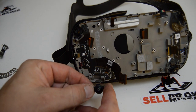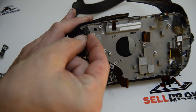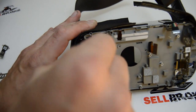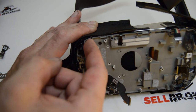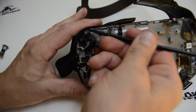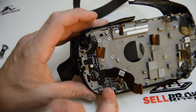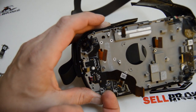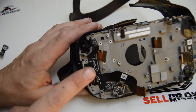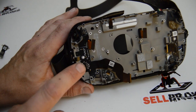Very much like a Mac, this little camera just pops up and off - just use your fingernail. It looks like this one they've covered with some kind of rubbery tape - almost feels like plumber's tape. This ribbon is held on by some decent adhesive, so I'm going to leave this ribbon in place rather than risk destroying it. I'll have to fight with the connector and get a little bit of slack on that.